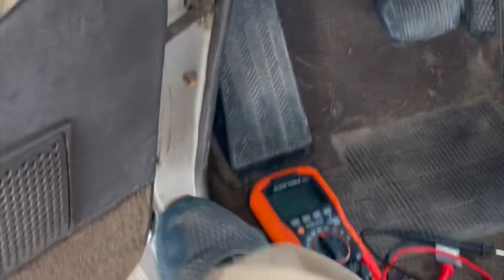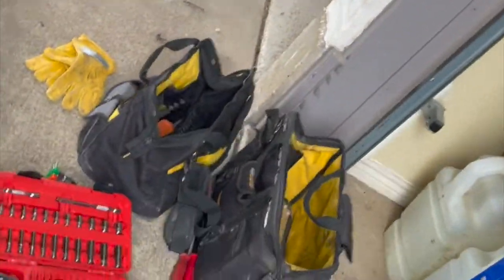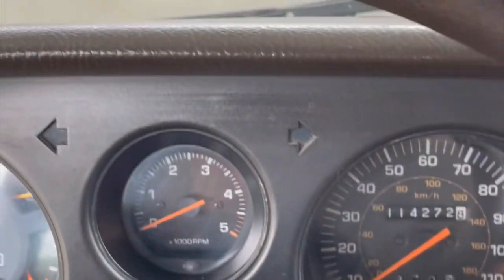I got some good advice. There's a diagnostic connector — we went in here and jumpered BP and FP. You can't read the inside of the connector but they're labeled: that is battery positive and fuel pump. When I did that, I heard some noise — the fuel pump kicking on. So now that we have a reasonable suspicion that the fuel pump is on, let's see what happens.